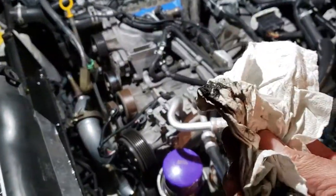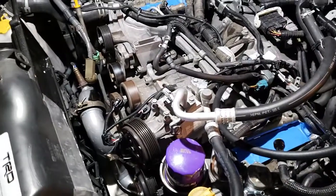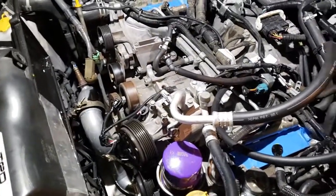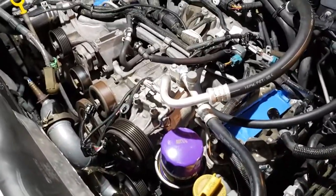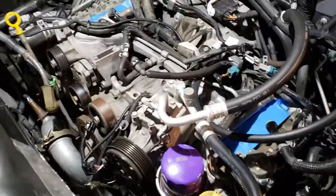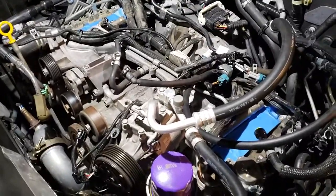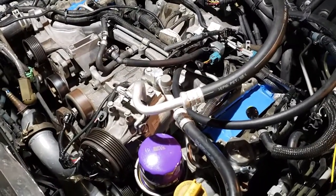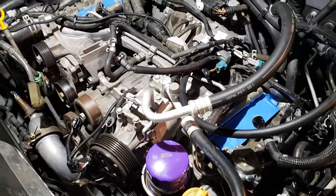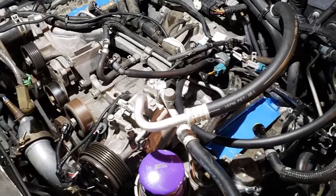The ports were black. This is an example that was coming out of the intake ports. Not the intake, but literally on the sides of the intake port. The fuel injector, that E85 was doing a good job at cleaning. The middle of the port was clean. Cleaned all the oil and carbon off of there. The edges still had oil on them. I cleaned that oil out. And then the valves have just a little bit of carbon on the back sides. I'm going to try to mess with that, see if I can clean that out of them.